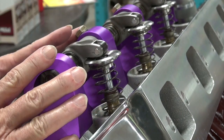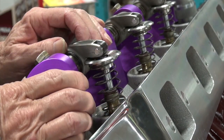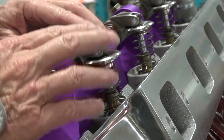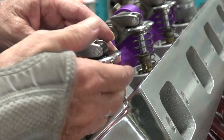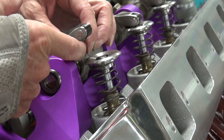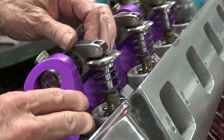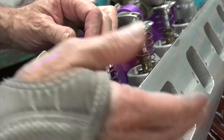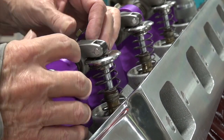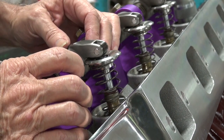With this particular head, this particular rocker arm, this particular retainer, I've got interference. Now if I could find some flat retainers - this intake side had too much open height anyway - if I had retainers that were flat instead of dished, this would probably clear. That's another angle I can look at. You can find Hemi valves with a 250 tip that would solve the problem, but remember these are 2.32 intakes, which is not standard by any stretch of the imagination.